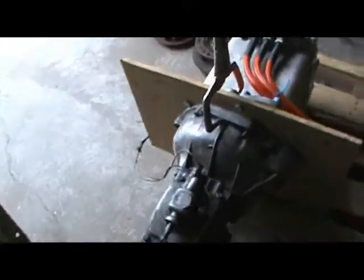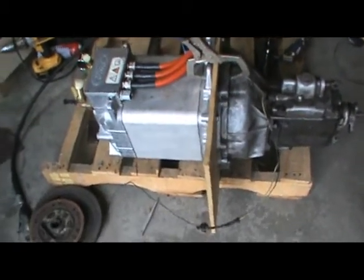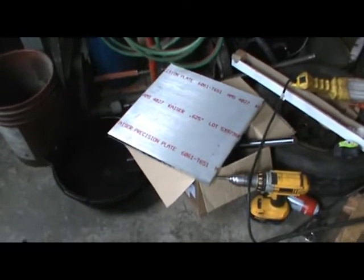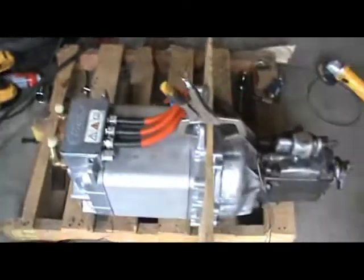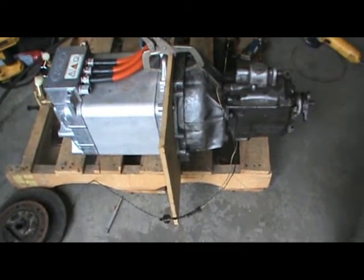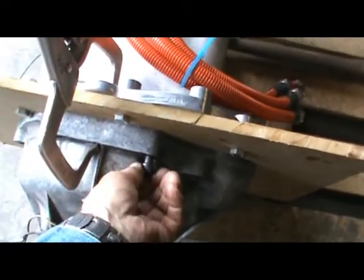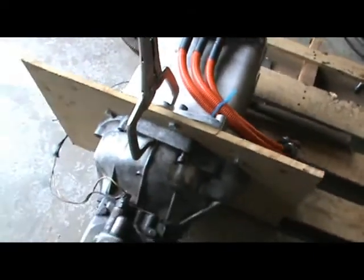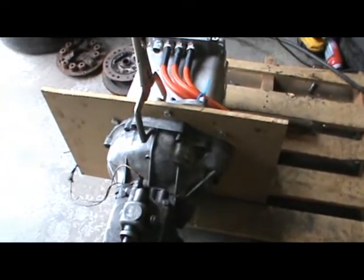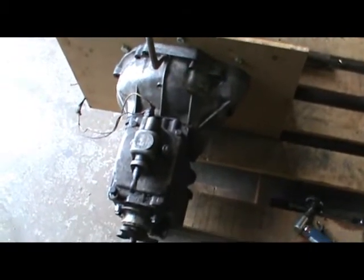We have our adapter on. This MDF is 1/2 inch. This aluminum plate we're going to end up using is 5/8. Boy, it mounts right up here and fits perfectly. We don't have long enough bolts, not enough bolts here in the 10 millimeter to go through properly into the MDF. So we had to put a clamp at the top there, but it's on our dowel pins.